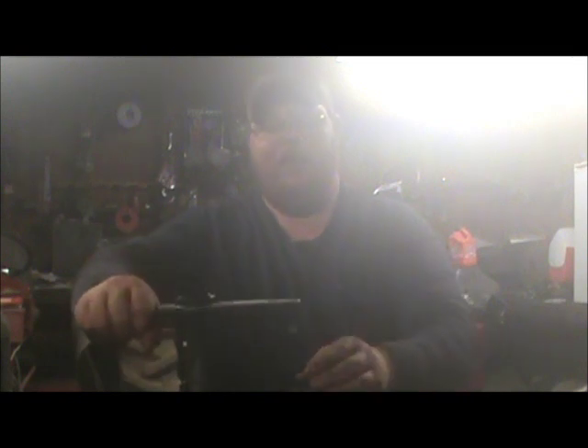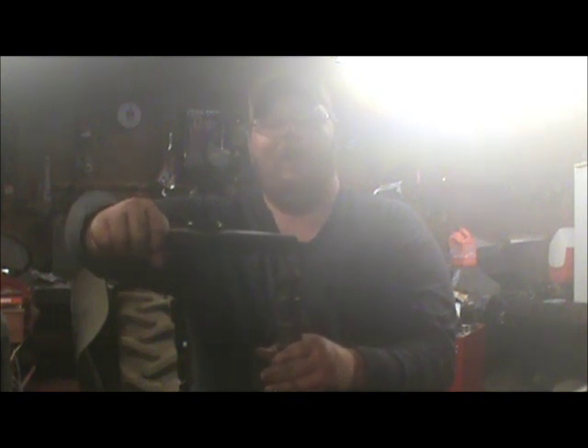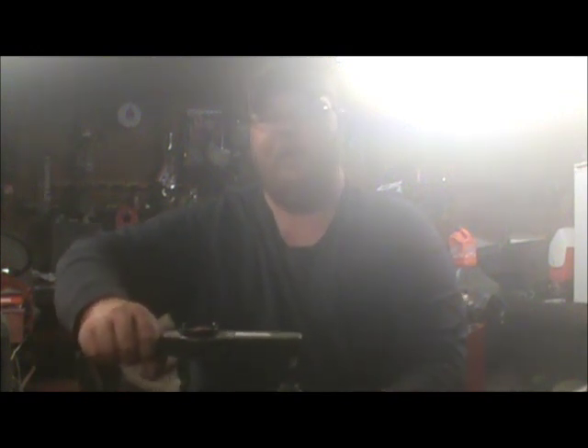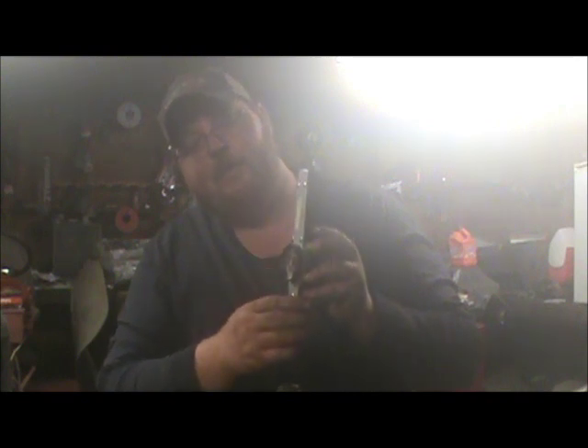A lot of people say you shouldn't do it with an impact wrench, but whatever technique works to crush this sleeve — it is possible with an impact wrench, you just got to be careful and don't over-tighten it. Because once you over-tighten it, you got to get a new sleeve since it's crushed down to the point where you can't get the right spec on your bearing preload. To set the bearing preload you need a dial torque wrench like this — it's a 3/8 drive, you'll probably need an adapter for a large enough socket — and with no load on the rear end, it's best not to even have the differential in it.